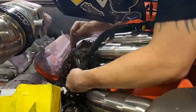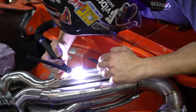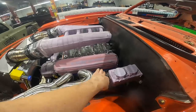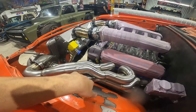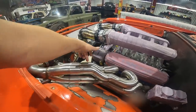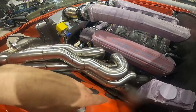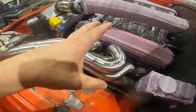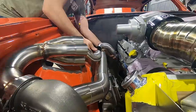Our driver's side header is pretty much all set — I'm going to let this chill and go over to the passenger side. We'll start making primary one and use the driver's side as our guide. We know the exact shape and order: cylinder four, cylinder three, cylinder two, cylinder one. Once that's all done we'll pull both headers out of the car and start building our fixture — I'll show you exactly what you need to do to weld these headers up and not have them move.